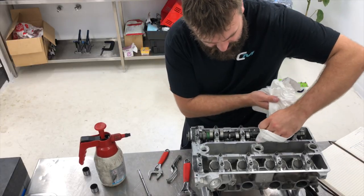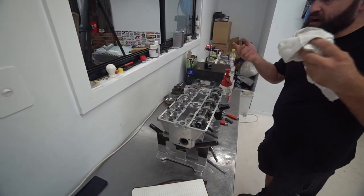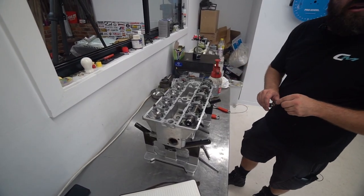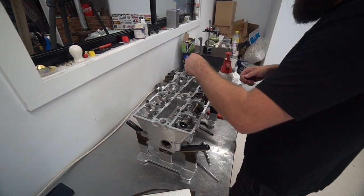And then the other thing too is the loudness. I've got to a point now where I can hear how loud it is, and then I go, oh, that's probably going to be about 12 to 14 thou. But I can't say that now because I already know my clearance and I've got a correction, so I know I'm going to be in the ballpark anyway. Yeah. But let's just start at 6.